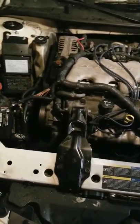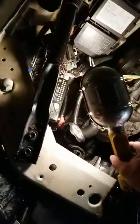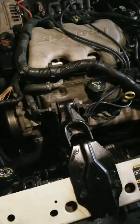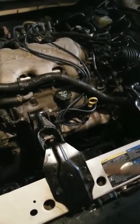If your car is overheating, it's not always the water pump. Usually when a water pump goes out, you start seeing fluid running down — there's no fluid leaking here at all. Right here at the very top is one seven millimeter screw, and right there is another seven millimeter screw. One is for the water pump side, one is for the thermostat side. You can't just do one side — you gotta do both. You gotta go back and forth to get the air out; it's gonna take some time.